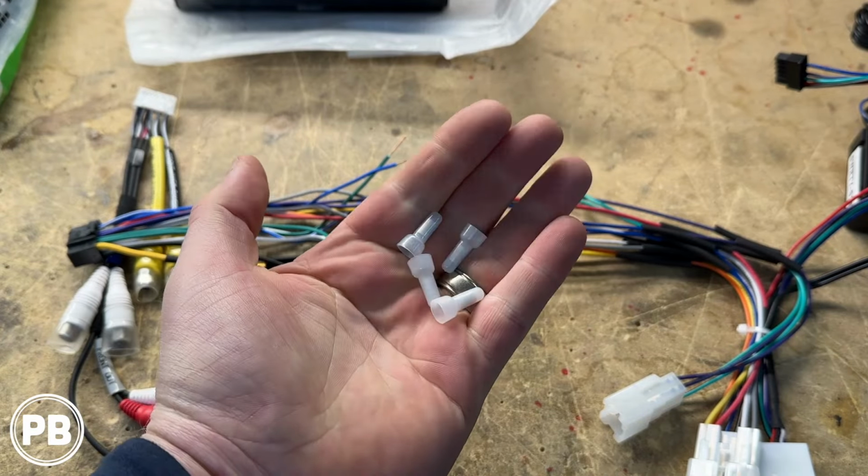For Toyota, if you look at your specific dip switches here, dip switch 5 through 8 are vehicle specific. So for Toyota, it's going to be off, on, off, on, or down, up, and then 1 through 4 is specific to your radio. Again, you're gonna have to use the instructions provided by Crux to know exactly which dip switch configuration with 1 through 4 is gonna pertain to your specific radio. Alpine, in our instructions, happens to be off, off, off, off, so we didn't even have to touch them, which was super nice. With Alpine, this end plugs into the WR, or the steering wheel remote input, on the back of the radio. And that's all done. That'll retain the steering wheel volume buttons.